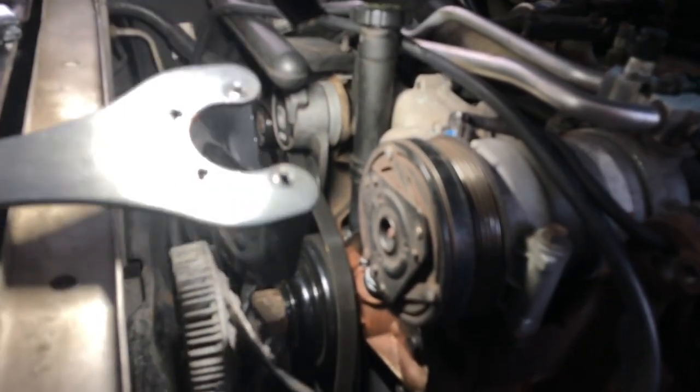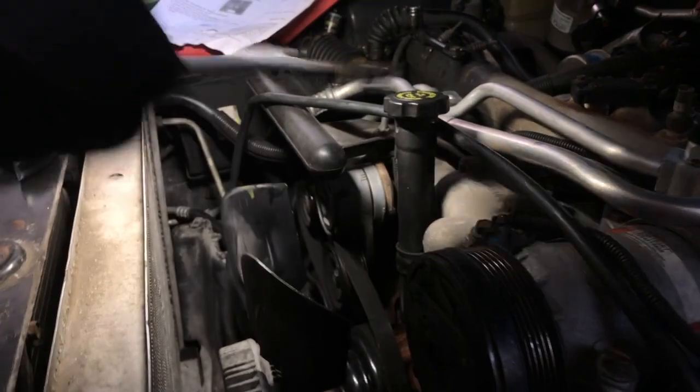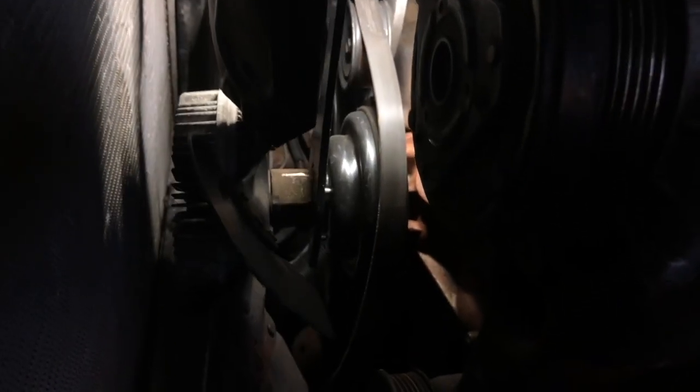And so this tool is going to go in there. This happens to be a Chevy product 61500B. I'll put a link to it in the description. This is what you use to get these kind of fans off. So this guy fits into the pulley like so, into those four holes. Just want to get him flush.